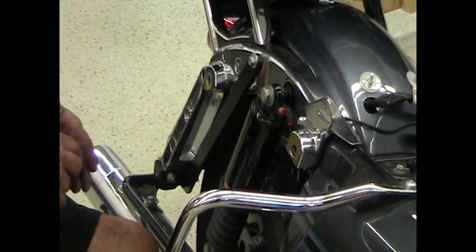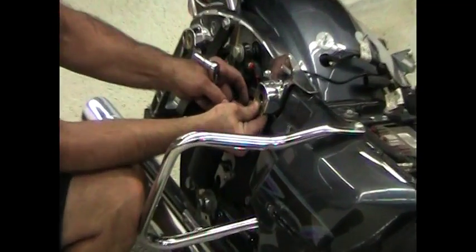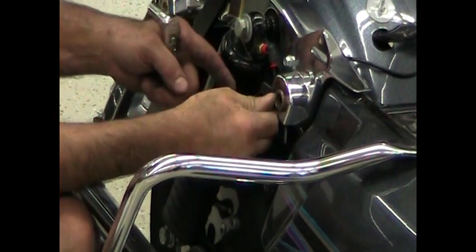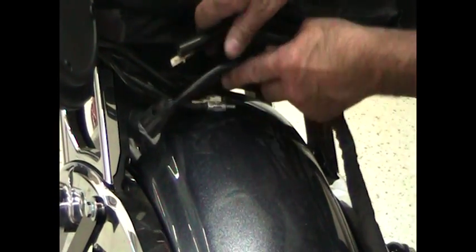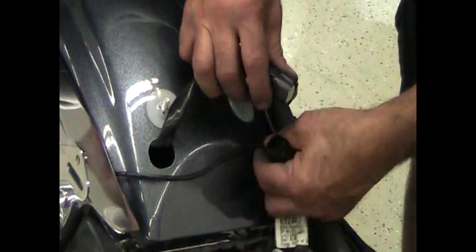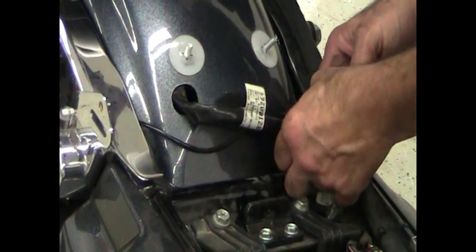Put everything back on for the hitch and the fender — the pin clips go back in and slide right onto the frame. Put our wiring back in place: all the wires to the tour pack reconnected, clips back to the frame, a cable tie back onto the frame, and the tail light wires back together and clipped in where they belong. Once you've got your trailer hitch installed, you'll need wiring to supply power for the lights on your trailer.